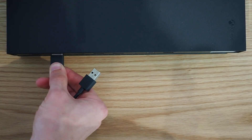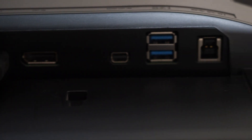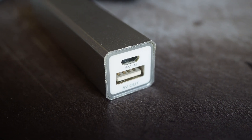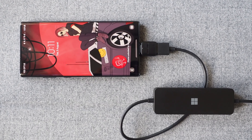But if you're a presenter and you want to be able to present content in a room while maintaining your mobility — freedom from wires — then this is the most simple and best solution out there. To use it, simply plug it into an HDMI port and a USB port; the USB port is there for power only. There's no software or drivers to install. You might find a USB port on the back of the TV or projector for power. If not, you can plug it into the back of your Surface power adapter, another USB power supply like a wall plug, or even a battery pack. I've even plugged this into my phone's USB-C port with a USB-C to A adapter, and happily ran my training session with that setup.